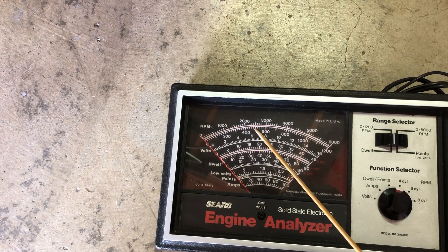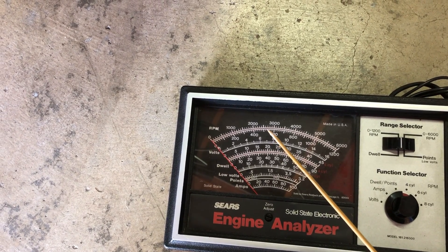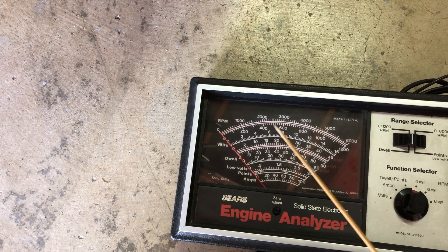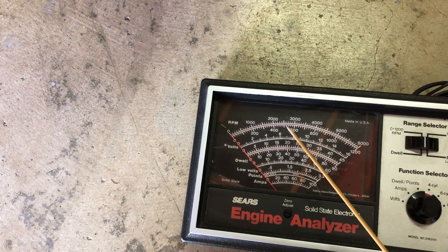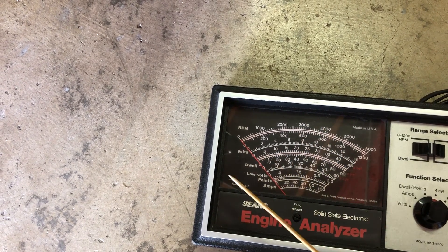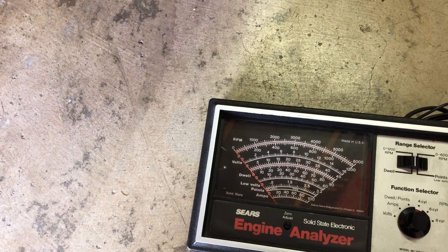Keep in mind that even though this motorcycle has four cylinders, it's got two coils, which means that whatever reading you get when you hook it up to one of the coils, you have to double it. Each one of these little divisions is 20 RPM on the bottom scale. So let's say your needle shows right here — that would mean the meter is reading 520 RPM. To get the actual RPM, you just double that, so that would be 1040 RPM.